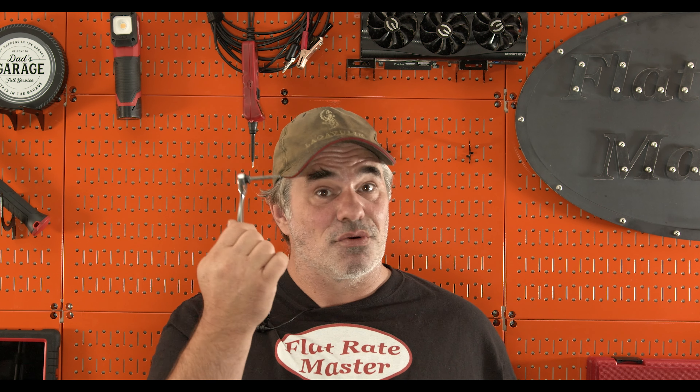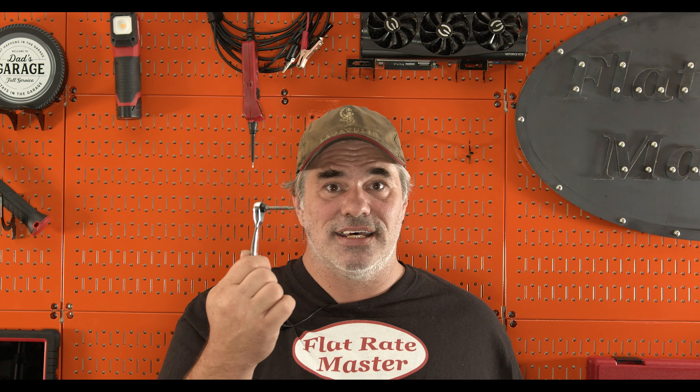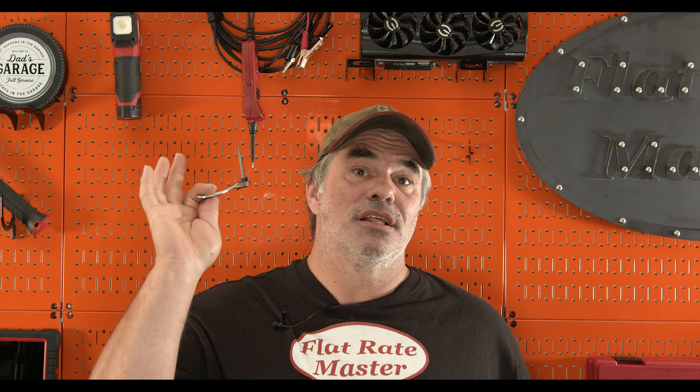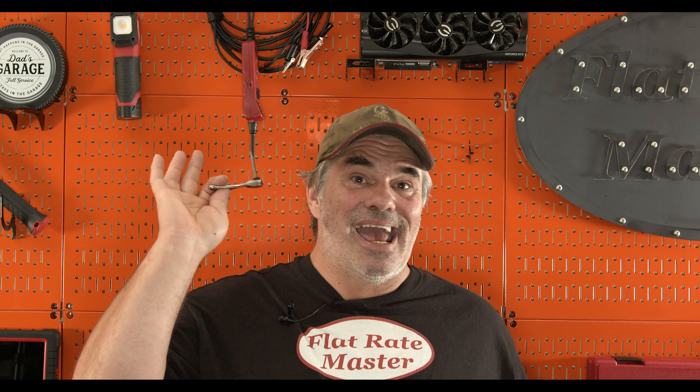It's custom designed for a certain ABS module on a Ford product. Don't ask me what it was — it's been years. I just remember doing an ABS module on a Ford product because it paid like nothing to replace it. The instructions were: remove the ABS module and HCU. And I'm like, it only pays 0.5. Screw that — custom tool to the rescue. I was able to unbolt the electronic part, which is what was bad. It had a relay failure. Pop it off, pop the new one in, screw it back up, tighten it properly. And Bob's your uncle. Custom tool saved me hours of extra work I wasn't getting paid for.